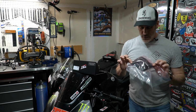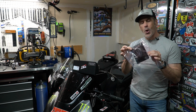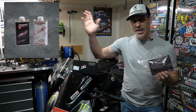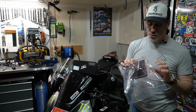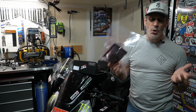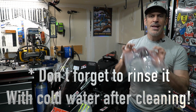Before we get started, a few things I want to mention. So that air filter from MWR is a reusable filter. When you purchase it, you can purchase the chemicals to clean and to re-oil the filter. In my case, to get this shipped from the US to Canada is always painful. So what I normally do, I simply order the air filter. I'll order a few of them, but I don't order the chemicals. I'm simply using some soapy water and I let it soak in the soapy water, just rub my fingers on it, clean it up, let it dry overnight.